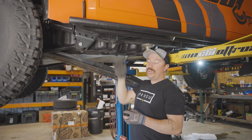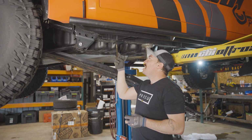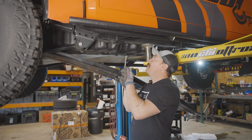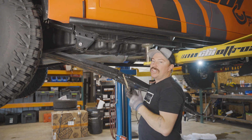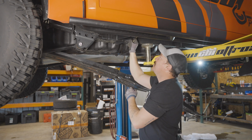On this rear foot, this is where the shim comes into place. The rear foot kind of lands on one of these bulges in the gas tank, and it's a lot closer than an 1/8 inch. So what we're gonna do is insert this shim between the frame and this mounting foot just to give us a little bit of spacing out so that we can gain some distance from the fuel tank.